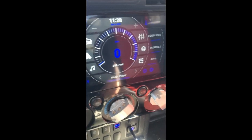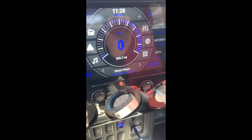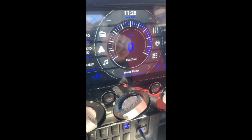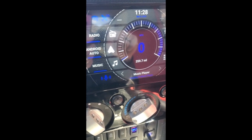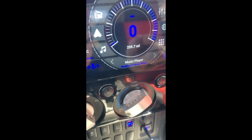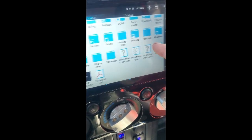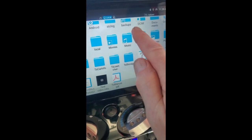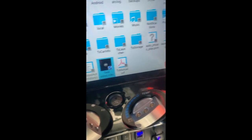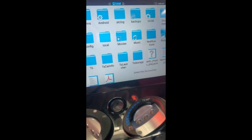There are all kinds of videos about how to customize the Agama launcher, but here are a couple of things unique to this particular head unit. One is how to delete that annoying video that comes up every time you launch — the video of the chef cutting the duck. Go to apps, then file explorer, go to the test video folder, touch and hold until it selects, then hit delete and confirm. Now it's gone.